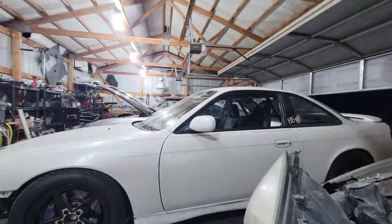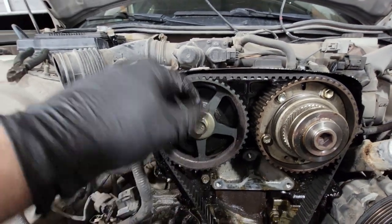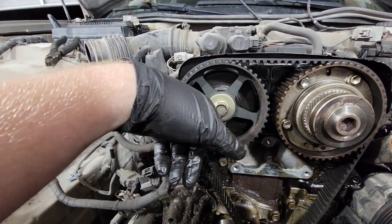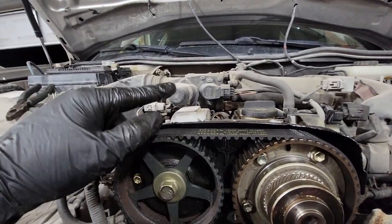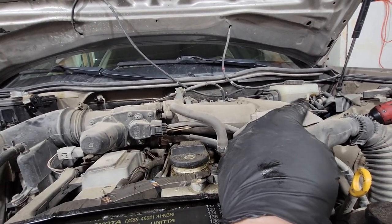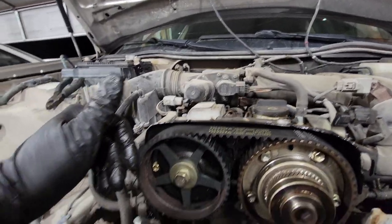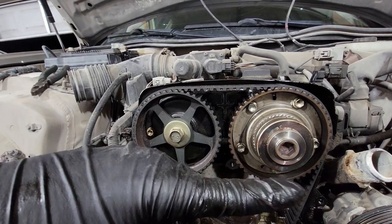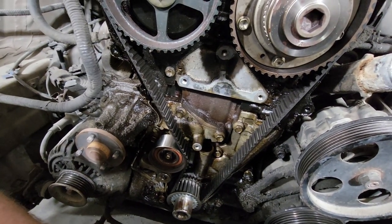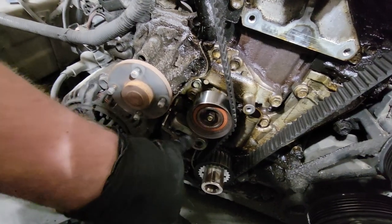As you can see, these seals make a freaking mess. The seals I'm talking about are right behind the cam gears, but they're behind this cover. In order to get to that cover you've got to remove the cam gears. In my case my valve cover gaskets are not leaking, so I'm just going to do this with the covers on. If you're going to remove the stuff on top, you'll have to remove the intake — there are a few bolts right here on the top — remove this whole crossover portion, then you should be able to access everything on top. But in this case I just need to address these ridiculous leaking seals. For your timing components, all you've got is this one little pulley, this one roller, and then the tensioner. You just need to remove the tensioner using a 10 millimeter allen, which will slack up the timing belt so you can remove it.